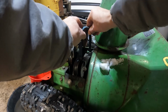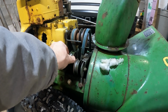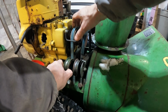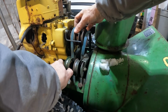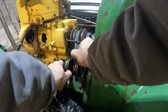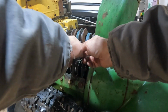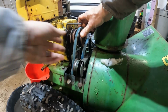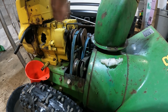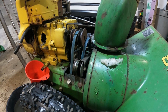So this belt, well, that just comes right off. That's a piece of cake. This one has, I see, a tensioner. I'm gonna pull that off there. I think we're gonna have to loosen that just to give us a little more wiggle room. But maybe not. Well, yeah, we will. All right, so what we might do is actually wait to get that off until we loosen the whole engine and just tilt it up, and that'll work itself right off. Piece of cake that way.